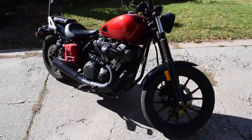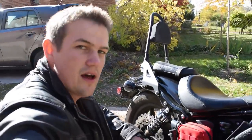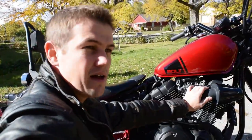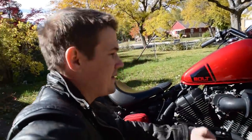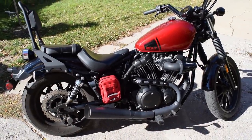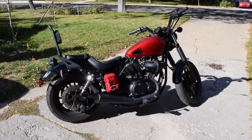To compensate for the increased airflow through the intake and the better back pressure on the exhaust, I did have to add a FI2000R Cobra fuel controller. With just the exhaust slip-on I felt I didn't really need it, but I was getting some backfire and it was spitting a lot. When I added the intake I was running really lean, so I made sure to add that fuel controller. It really helped level things out — the backfire popping went down a lot. Every once in a while it pops but nothing serious. It's running a lot closer to what it should be as far as air-fuel ratio. That's pretty much it for the Bolt.